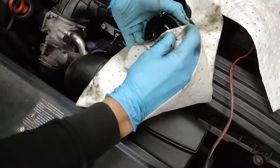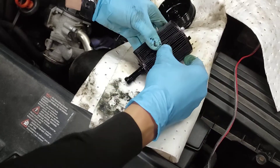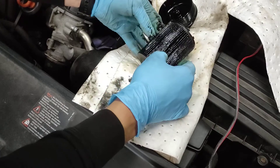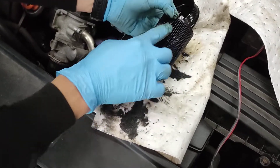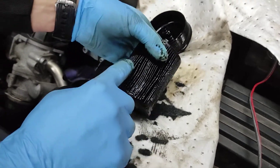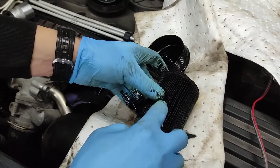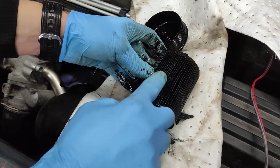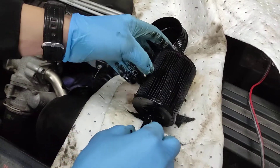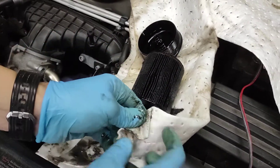I have the cap, I have the oil filter with a little thingy on the top. I can hear the oil draining. Let's see what filter I put in last time. I think it was a cheap one. Can you see how it's not evenly distributed - the filtering material is not evenly distributed. That's a bad thing with filters. We've got somewhere a lot more filtering paper than other areas. But that's because it's so many miles - I think it's like 12,000 miles on this filter.